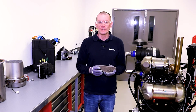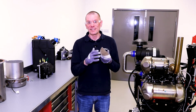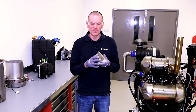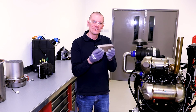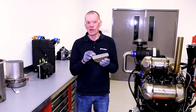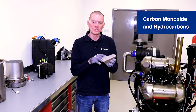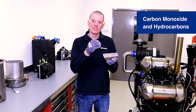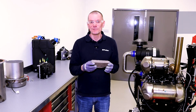The second element is the precious metal coatings on this substrate. Those precious metal coatings are things such as palladium and platinum. Working together with the heat generated through this diesel oxidation catalyst, they convert those harmful gases — carbon monoxide and hydrocarbons — and the chemical reaction changes those into carbon dioxide and water, which are much less harmful emissions.